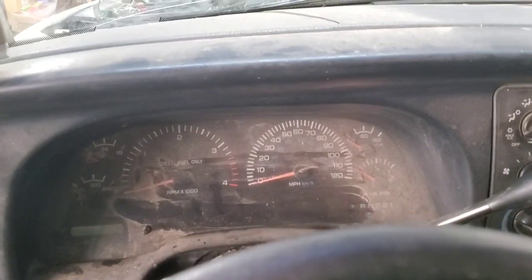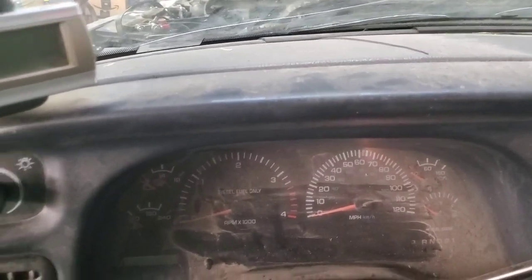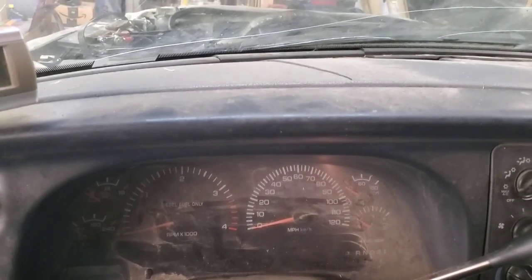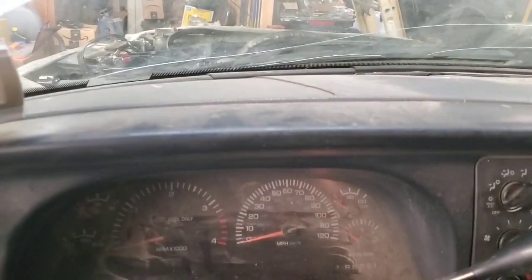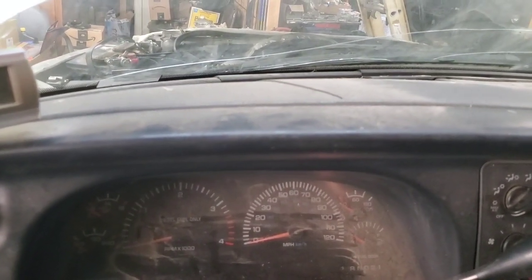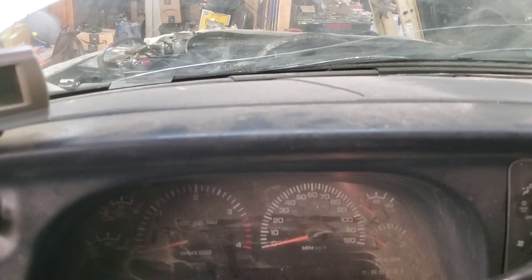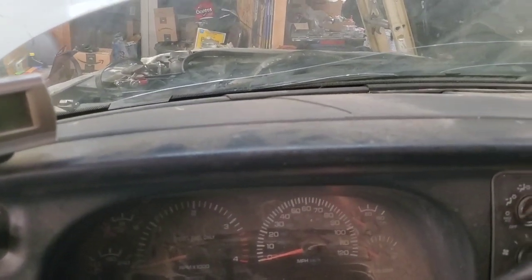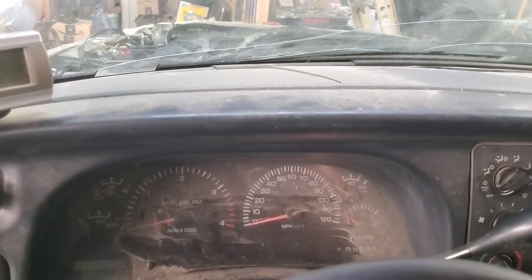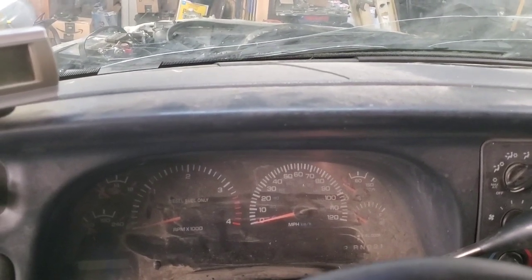When you've got one of these pickups with this style, I'm not an expert — I'm running an independent shop, just started a couple of years ago, and running into these things. I had one that I troubleshot for days trying to figure out a long crank before I realized it had a bad ECM causing the long cranking, because I was chasing fuel issues, sucking air, this that and the other. With the other pickup that was a crank no start, you'd turn the key on and you'd never see the wait-to-start light.